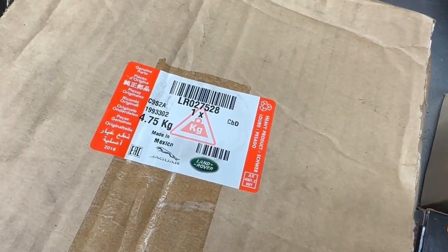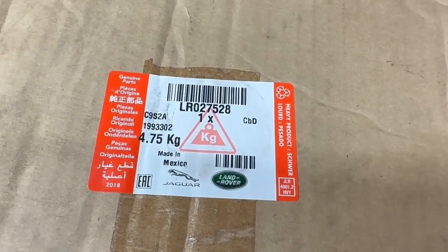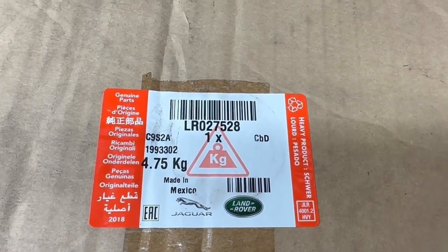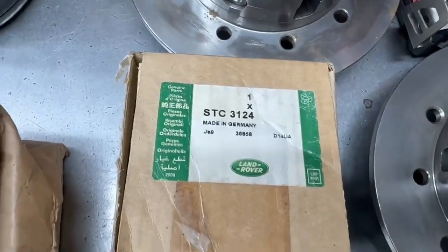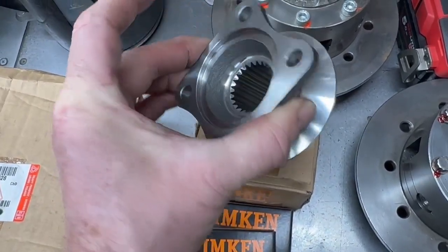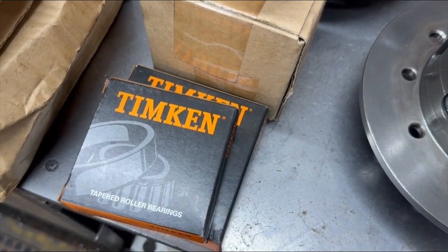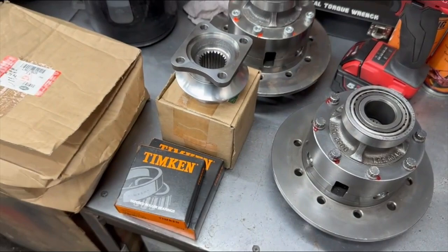It's rare that we reuse a short nose crown wheel and pinion — they often have a lot of wear because of the flexing, and they're going to be noisy. The pattern ones out there are not very good, so we use genuine ones — actually made by Dana — and they are beautiful gears. They just happen to have that design flaw of being so damn thin. We have a huge number of genuine Land Rover dry flanges — about 12 times the price of a pattern one, but quality is in a different league. We've fitted our short nose super flange, and a couple of Timken bearings — there's a head and a tail. We only use Timken — best you can get, don't cut corners.